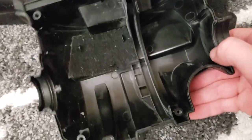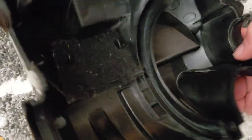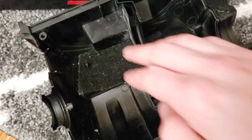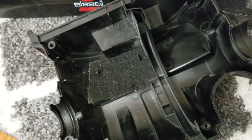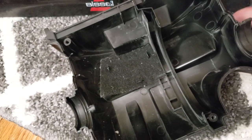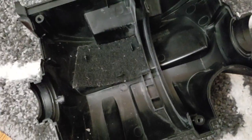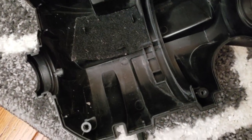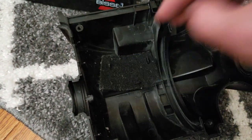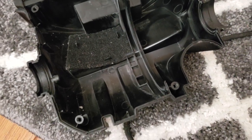And I would recommend, if you want this thing to be in good shape, if you're using really, really poor quality bags, pull this apart and clean this maybe every 2 years. And if you're using really high quality HEPA bags, then you shouldn't really ever need to clean this. It should never really get dirty to the point where you would actually impede any sort of airflow. Obviously, this is the exhaust filter, so suction isn't really a concern. It's more so just, could you be overheating the motor by forcing it to push through a filter that's clogged and restricting the outward airflow?